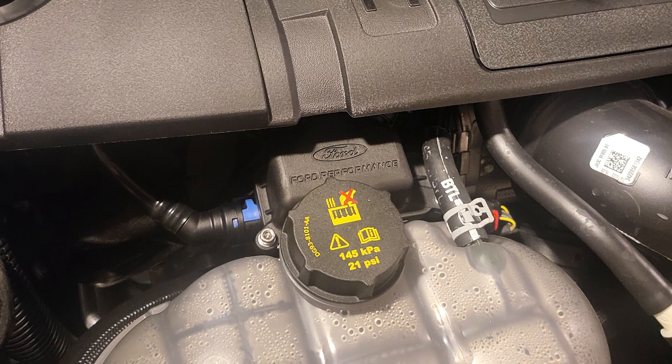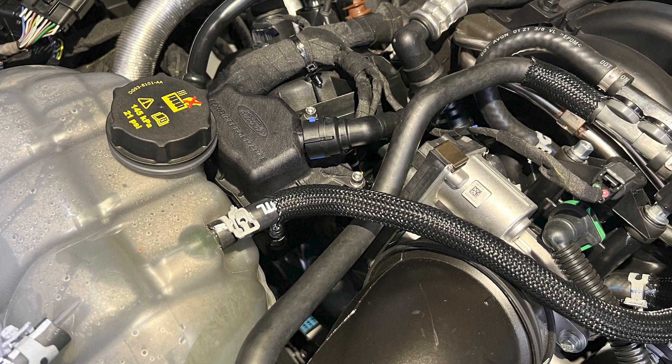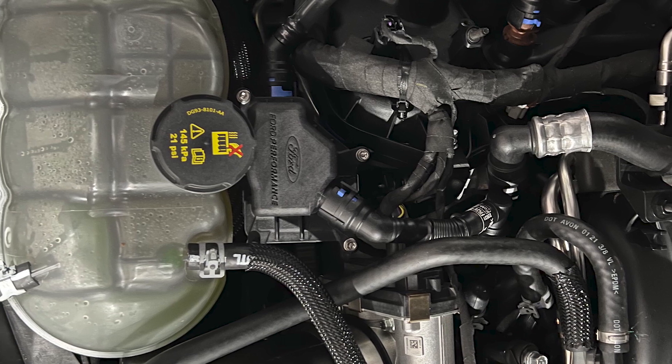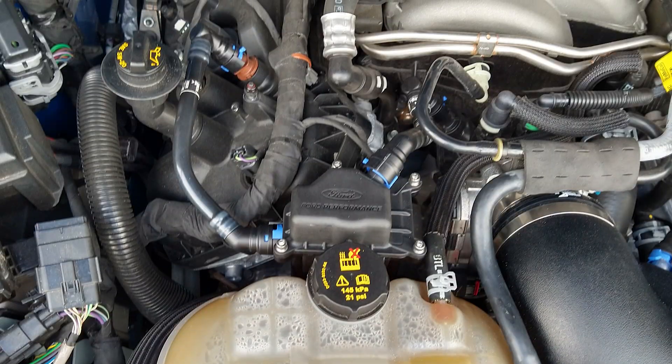This separator is definitely larger than a lot of the other ones I've seen. It's made from precision-molded hard plastic that seems really stout, and it's going to fit nice, look nice, and withstand some engine bay heat as well, all while not rusting. What makes this different than a normal catch can is that the air actually gets passed through filter media, rather than just having the vapor collect in the bottom of the can. This is going to give you a great result when it comes to clean air, and it really sets this one apart from other universal catch cans.